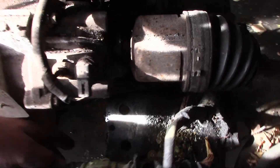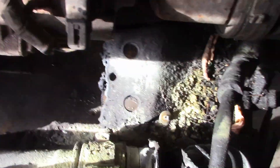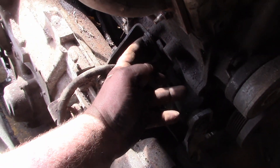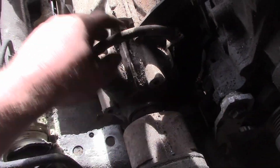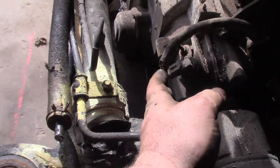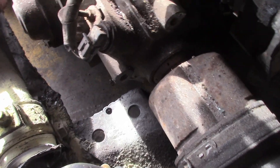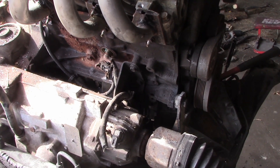This one right here is going to be a little tricky because I guess I didn't have to cut as much as I did, but I did cut that much. As you can see how much of the subframe I actually did have to cut out. So we're going to build a mount that mounts to these four locations. I don't really want to get rid of this because I think that's kind of necessary — I know these have a lot of twisting torque on them. Bring it off of here and then a pipe that comes down and mounts to there. I'm not exactly sure how I'm going to do this, but we'll try to come up with something.